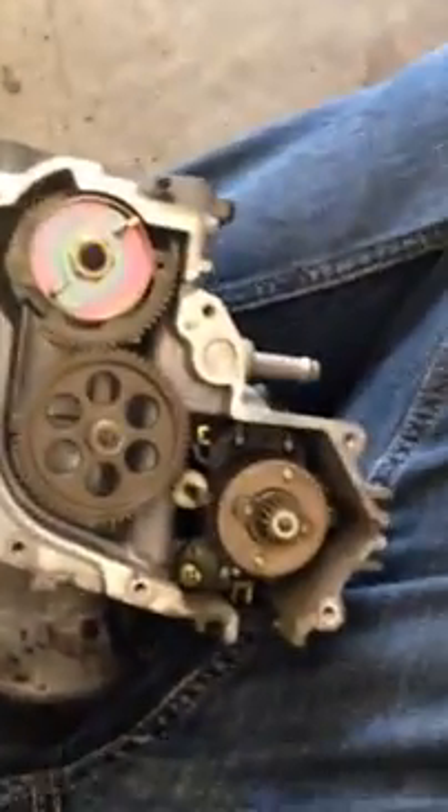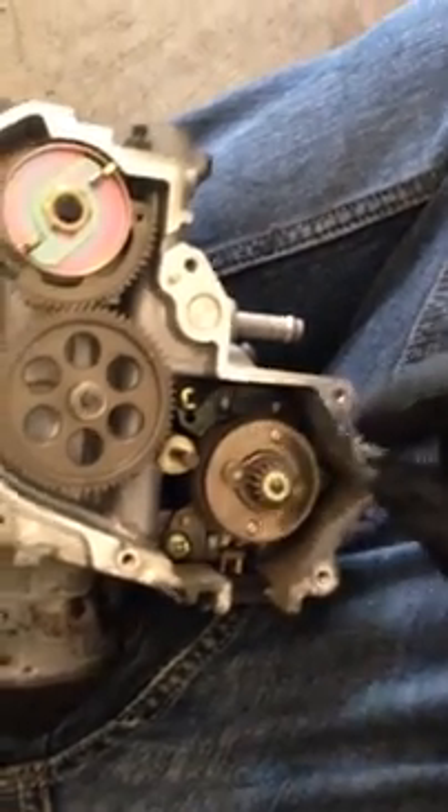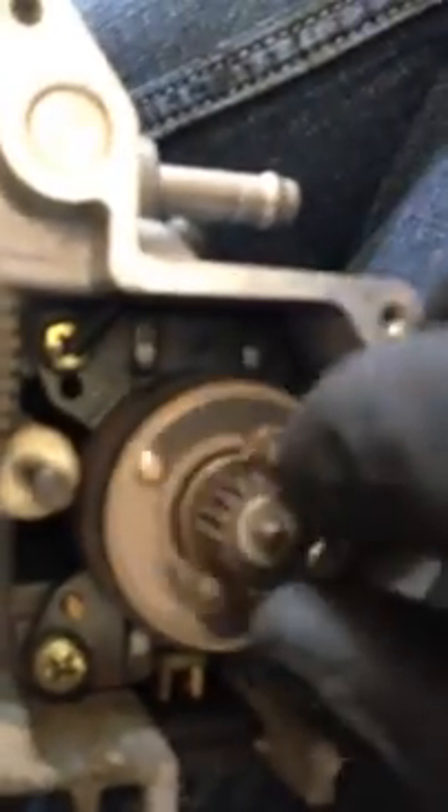Here's what I believe is the defective unit that I'm going to be replacing, and here's what I found. [Demonstration] — smooth, real fast. Obviously there's an issue with the clutch in there. It's not spinning the electric motor — I don't feel resistance like I'm turning armature and brushes. This is just the clutch slipping; you can hear it.